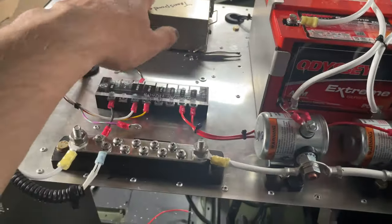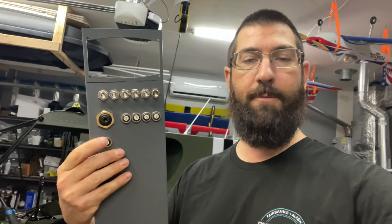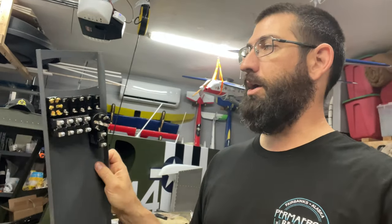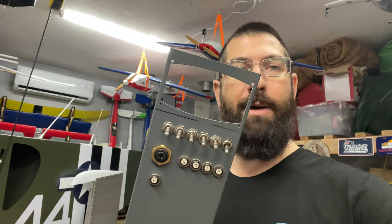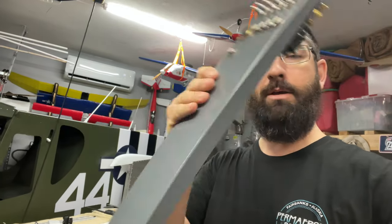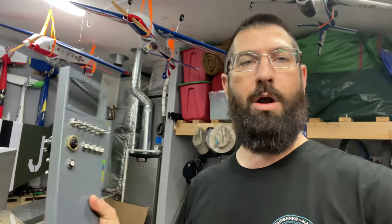I do have my transponder and my COM radio over there now. I got my new switch panel here from Viking Aircraft. They do a really nice job. Now these are not the switches they give you, except for the key — that part is what they give you. This panel is a much thicker aluminum than the one that comes with it, which is great. What I'm going to do is cut off the top half where that black line is so I can fit this into my center console properly. They give you a long piece of aluminum that's not bent, so I'll have to measure, cut it to the right length, and make my bend so it completes into the center channel properly.